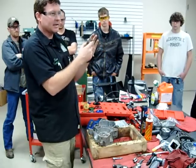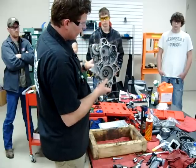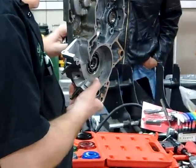This particular bearing also has our steel race — we know it went down. We're going against this lip inside the engine. If we go too far or drive it too hard, we'd end up breaking that.